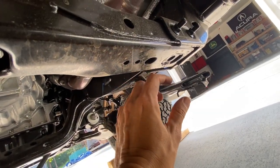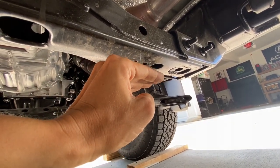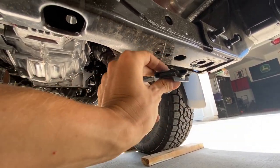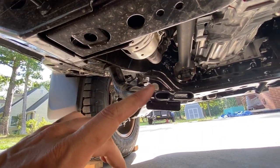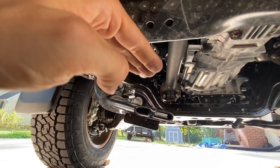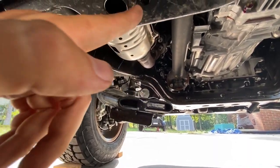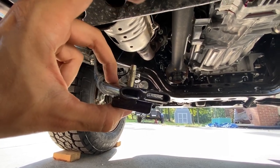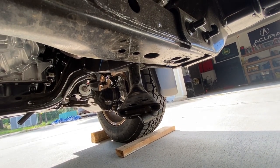I think this is going to be an easier method — go ahead and just remove all but one bolt for these cross members so the things are free right now. What we're going to do is sandwich the plate between this cross member and this brace, and then we'll bolt it in position rather than trying to fight the plate and finagle all four bolts. Leave one bolt in position on each side. My next step is to take the assembled plate, put it upwards, and try to sandwich it between this cross member and this little brace right here, throwing a bolt into it.